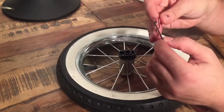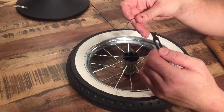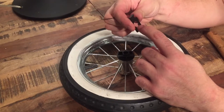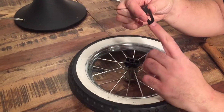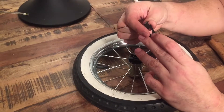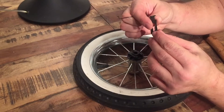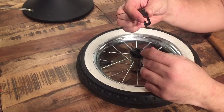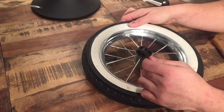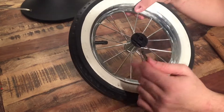That allows you to take this entire piece out. If you need to switch the wire, that's what's broken — you just pull it out like that. As this slides down when it's lower, this larger circle would be in place with the shaft, and the axle can then push through. The axle has a groove so that when the spring bounces it back up into place, this smaller dip locks in around the axle. This piece can sometimes break, sometimes it's the spring — it can often be this piece as well, right where the spring goes into this hole.